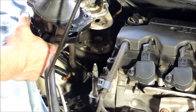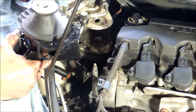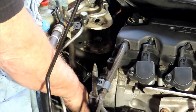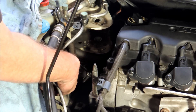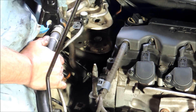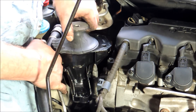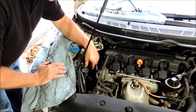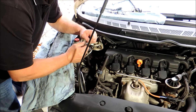The process is the reverse of what we just did, starting with that last bolt. So how many bolts did we actually do? One, two, three, four, five, six, seven, eight — nine, ten for the dog bone. It's about a ten-bolt job, not a big deal, just using common hand tools, nothing fancy. The bracket stayed in the car. You might want to lower the motor a little bit on the jack to get the new mount in, but you should be able to get it in without that. Turns out I didn't have to move the motor — just jimmied it around and got that other bracket in place. There's actually a little clip on it, but it just clips on, so no tools required.